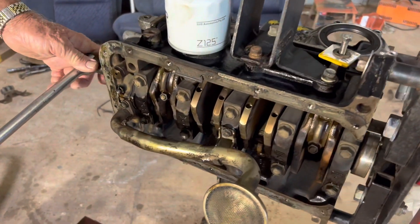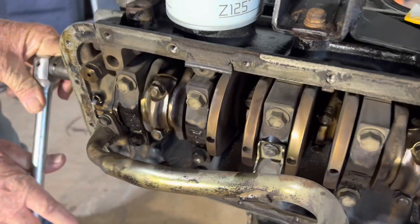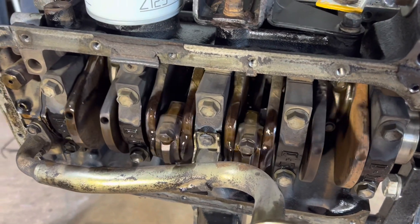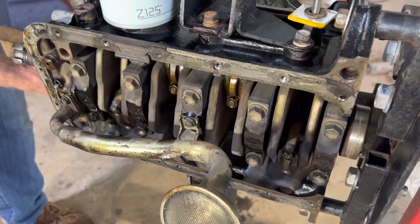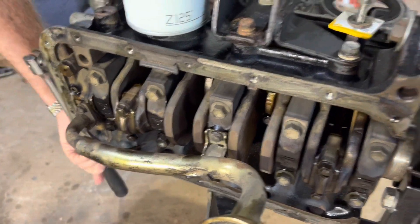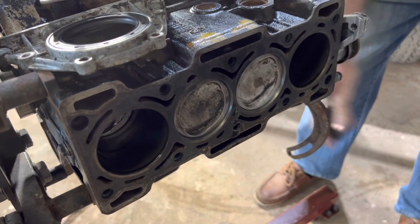The sump's been pulled off and everything's thoroughly cleaned in there, so it's going to be an easy job just to undo the big ends and get the pistons out, have a look at the rings, have a look at the bore. From what we can see, the bore looks to be in pretty good nick. There's a bit of a watermark in number two from where the head gasket was leaking, but it doesn't look too bad — no big pits, everything still turns over pretty good. Had to give it just a light sand in the bore; it was still turning over with very light rust in the cylinder. So that's going to be the next move — pull those pistons out and have a look.